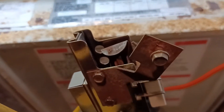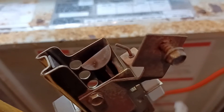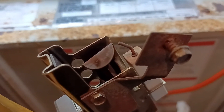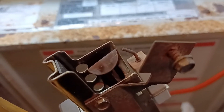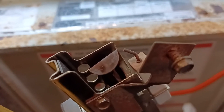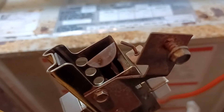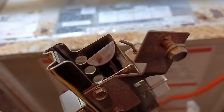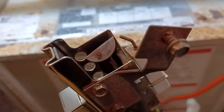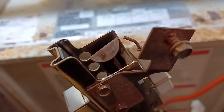The gap between the tip of that igniter and the sheet metal is too close. So it won't ignite the gas. I'm going to put this thing on and show you that it won't ignite the gas — even though the pilot gas comes out, it won't ignite. So the pilot light won't be lit.